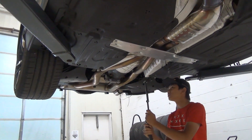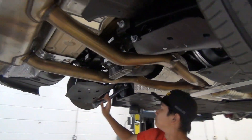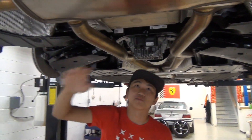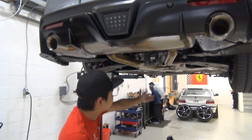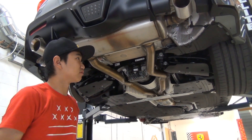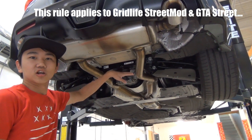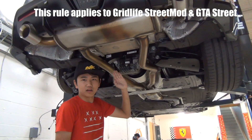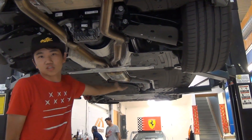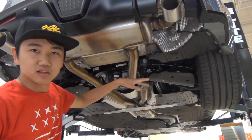The rear diff area is a little more open, and for the rear control arms there's a big air guide for guiding the air right through into the back. The exhaust makes it kind of flat — basically a flat floor. What's interesting about time attack is that flat floors: you're not allowed to modify your factory floor area between the front and rear axles. On the S2000 that whole area was completely open — free downforce just being wasted — and now it's a flat floor. This is not cheating; it's reading the rules.